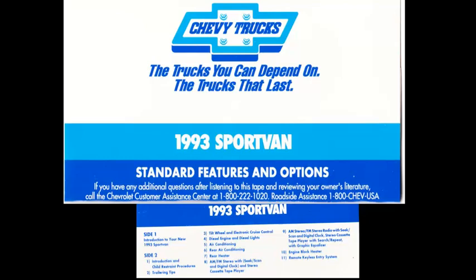The type of hitch you have is very important. If you have an aftermarket hitch, make sure it is properly installed and adjusted. Two very important hitch considerations for trailer weights over 2,000 pounds are that one, the hitch is a frame-mounted, weight-distributing hitch, and two, you install a sway control system of adequate capacity. Improper trailering or not following recommended trailering tips and cautions may cause handling problems. On trailer weights over 1,000 pounds, you should have trailer brakes. See section 4 in the owner's manual for precautions and special techniques to use when towing a trailer.